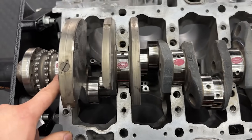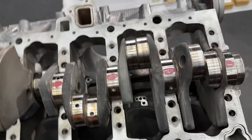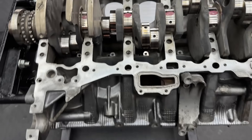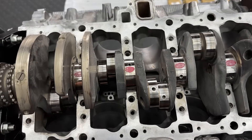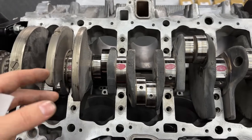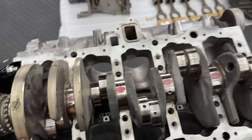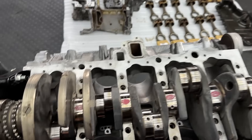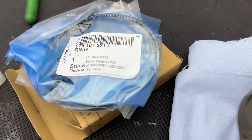So what we will have to do now: clean up all the red stuff from the crankshaft. We will be putting the piston rings into each cylinder, we have to measure them to check we have the correct gaps in the rings, then assemble them onto the pistons. Once they're going to be inside the bore, we will put them onto the crank and be measuring the clearance between the conrod bearings and the crankshaft.